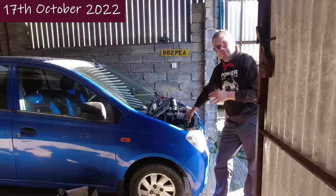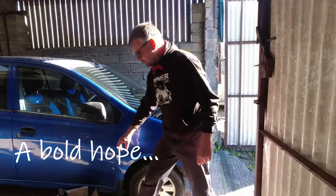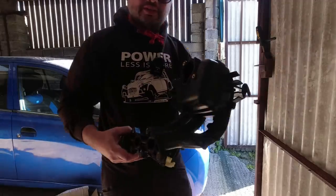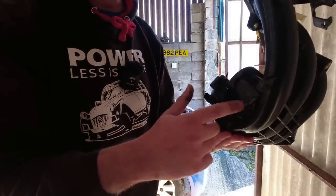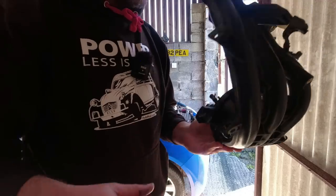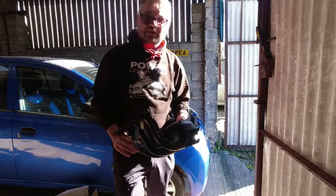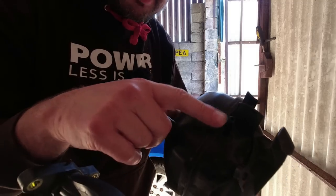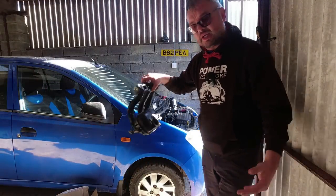In this video I'm hoping to finally reach the end of the Daihatsu engine swap saga. You'll recall from the previous video we replaced the inlet manifold because a port had snapped off. I tried to bodge it to get it working, which kind of worked, but that's where the brake servo goes. We bought another manifold online, fitted it, and then discovered last minute that the port for the MAP sensor had snapped off. So we've now got a total of three knackered inlet manifolds.